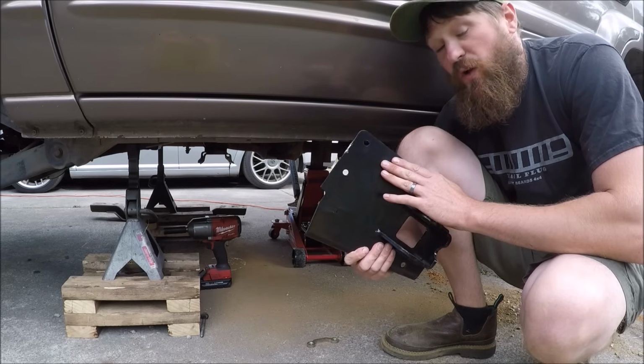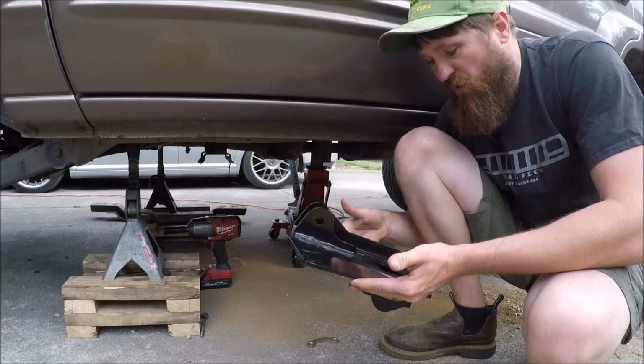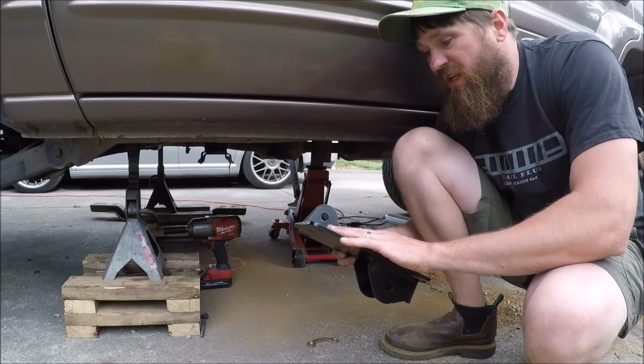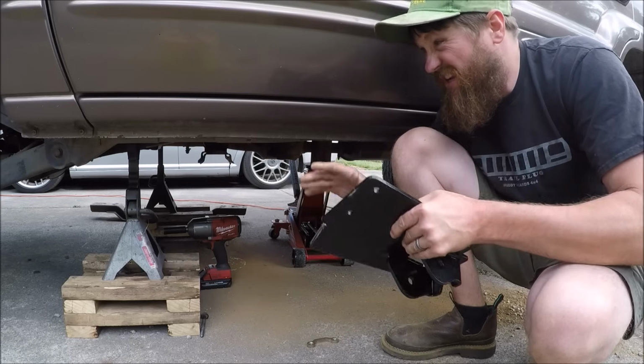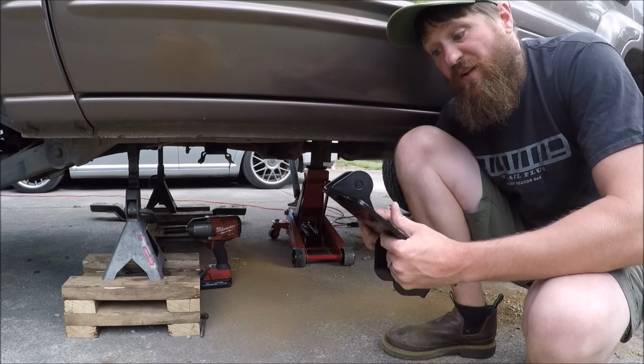Now, you could exercise the option to weld this. I'm not going to. I'm pretty happy with the way this is designed, and that'll be 6 total bolts holding in this outer alone. My uniframe channel's in pretty good shape, and so are all the mounting locations, all the threads and everything. So I'm pretty satisfied with the way that is.